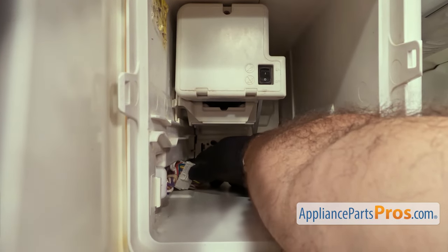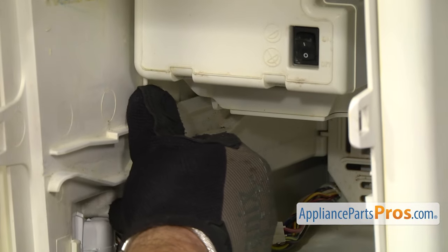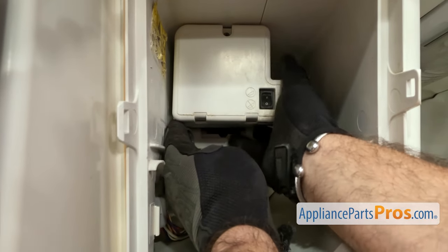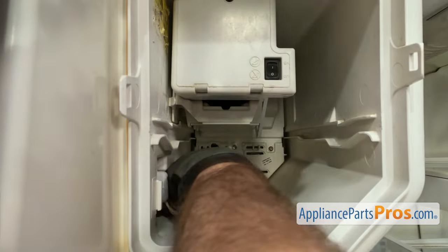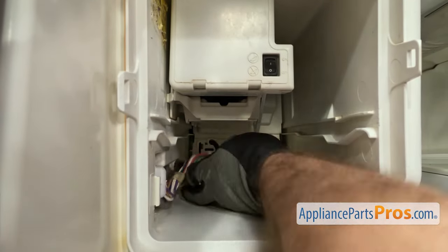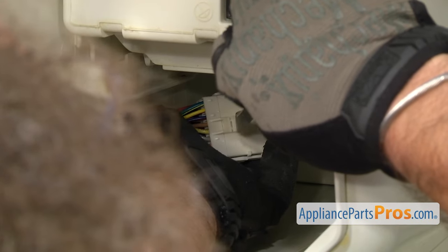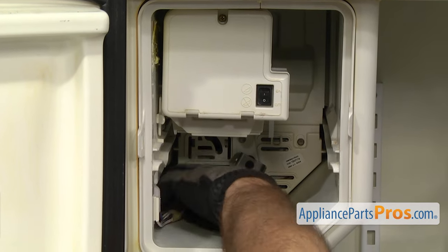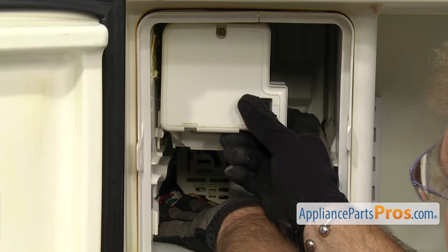Next, we have to release the wire harness. But because it's kind of tight, we're going to first release the ice maker. There's a little locking tab right here that we just need to pull out on. We can pull the ice maker out a little bit, which will give you a little bit of slack in the wiring harness. We can take the wiring harness — there's a locking tab in the middle that holds it together. We're just going to use a really long flat head screwdriver to reach in and press on the release tab, then separate the two halves. Once you have the wiring harness separated, you want to grab this side of the wiring harness and make sure it goes over to the side so it's not blocking the way. Then we can carefully pull the whole ice maker assembly out.